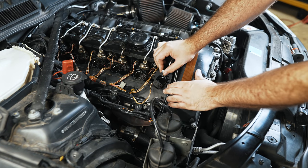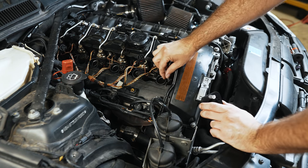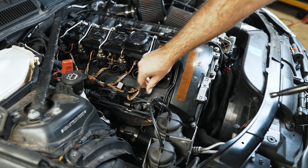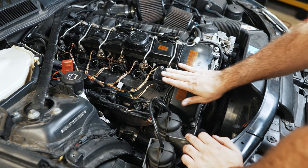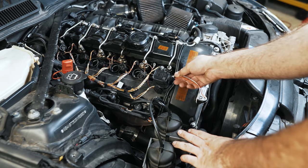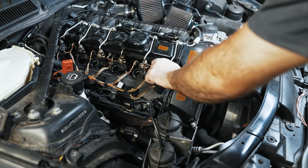As far as I know this plate is waterjet cut. It's made by a gentleman named Rich who just wanted to put this out to help the community. I like that it's not a huge bracket and not a big deal to remove if necessary. You basically screw these plates into place using a screw hole that's already there from the factory but otherwise serves no purpose. It's a T15 torx screw. Then you bring your B58 coil over and it threads right in. Your overall height isn't bad - the stock engine cover will still fit. The connector is very different even though it's still three wires, so the kit supplies a professionally made connector with the wires ready to go. I took these coils off my 440i - they have over 100,000 miles - but since we're experimenting here I'll use these and put the new ones on that car.